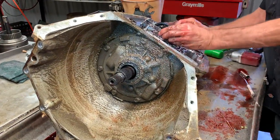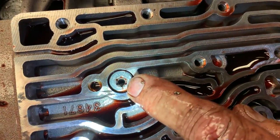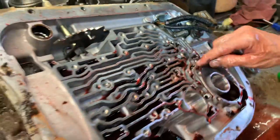If you notice, these bolts are hollow. This one here is hollow and this one here is hollow. This is your fourth gear clutch here, and this is your intermediate or your direct clutch. You also have your lube circuit running through here.